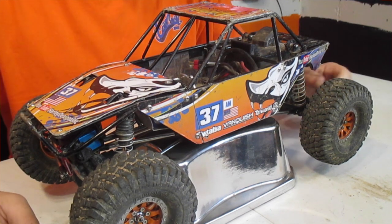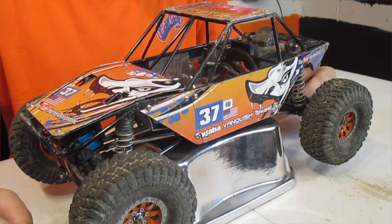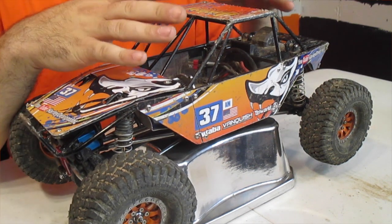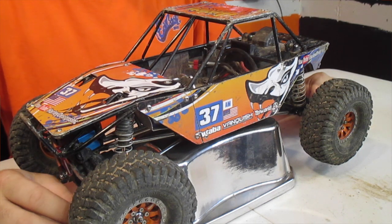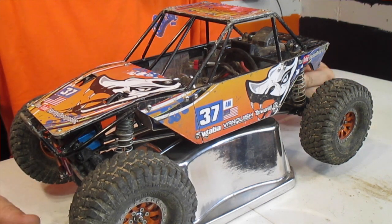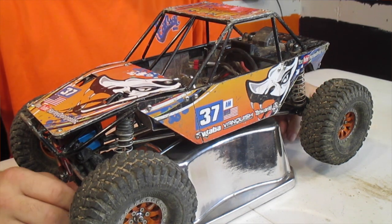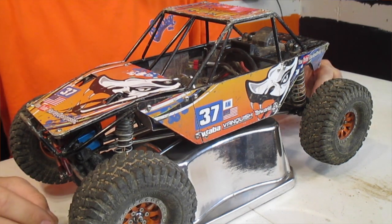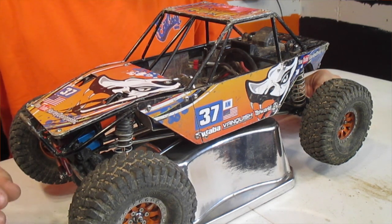So I knew that it was going to do that basically because when I originally built it, I left out a couple of screws in the top of the center of the axle case, and what that allowed is for the ring and pinion to separate slightly because that case was allowed to flex. My fault. However, I am running stock gears in this axle. Usually stock gears will last a pretty decent amount of time, but my fault for letting them wear prematurely because I left those two screws out.